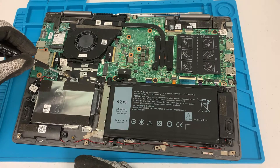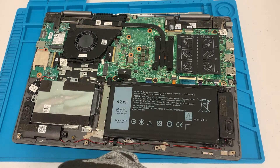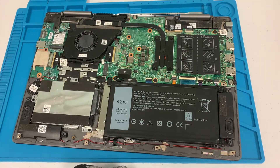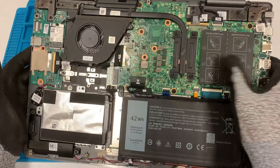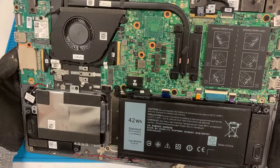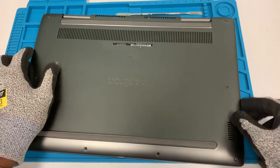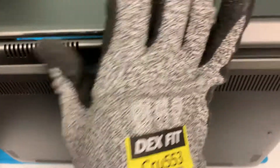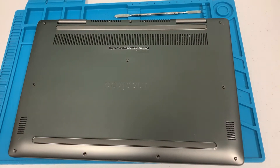For anyone looking to do the operating system installation, you should be able to find videos for that on our channel — I won't go over that step here since I already have a video covering it. So there you go — battery replaced, new SSD drive, two RAM sticks, fan is good and not dirty so no cleaning needed. Everything's all set; we can close the base cover. Try not to put too much pressure so you don't crack the screen — I usually open the screen up from this side. That's it for today guys — if you find this video helpful please like and subscribe and I'll see you next time.